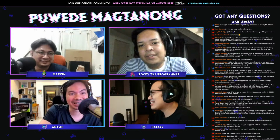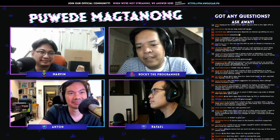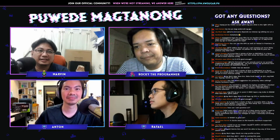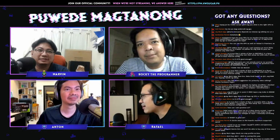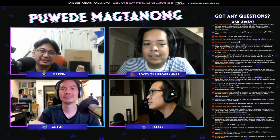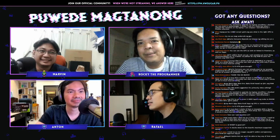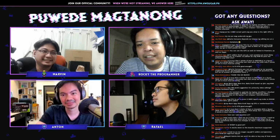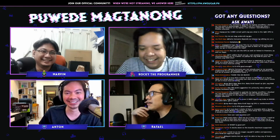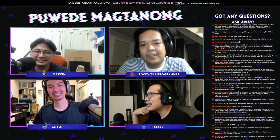Well, anyway, most likely it's the PSU or the VRM failing. I think it's either the PSU or the VRM of his motherboard that failed. What's VRM? It's like the regulator of the motherboard itself. Yeah. I don't think it's the GPU, because GPUs have safeties. Unless maybe he was running a really extreme overclock. Overclock? Yeah. No, impossible. The PC would turn off or the game would crash. It wouldn't allow it to continue.